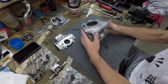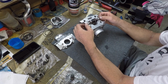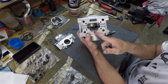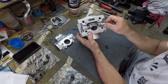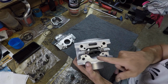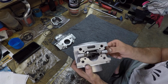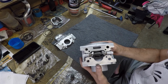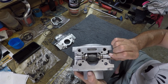Okay, let's get the power valves. This is the secret to the two-stroke, guys. This is the exhaust port of the head, and the exhaust pipe, the expansion chamber, comes off of that. This position is just normal running, low RPMs, two-stroke speed. Once the RPMs increase to a specific region, this is actuated into the open position. That's just normal riding, and that's a religious moment.